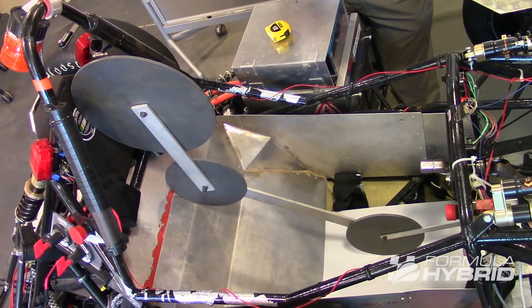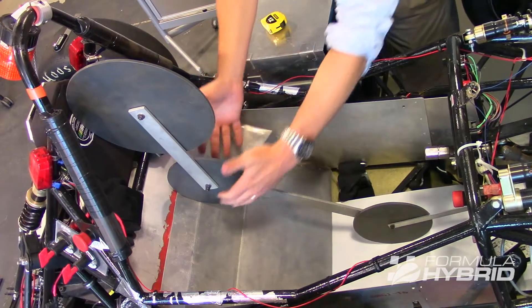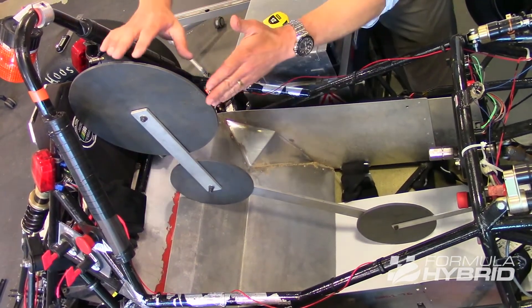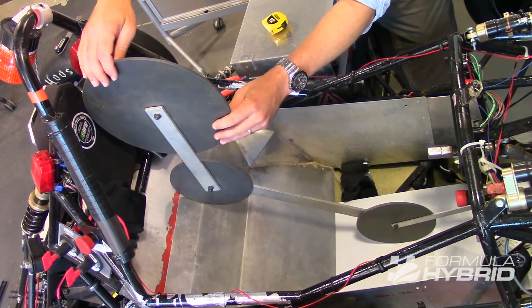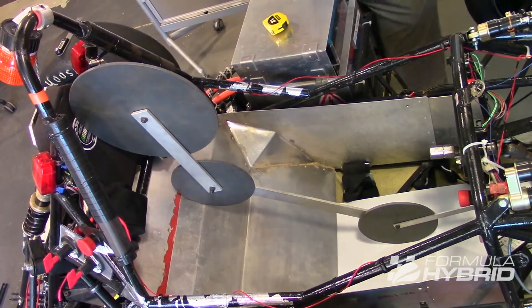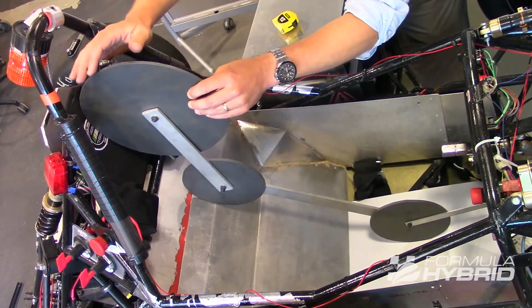Nominally, PERCY would have his own pads and driving equipment. PERCY's shoulders then sit back here close to the shoulder harness mounting bar. PERCY's head sits against the headrest and can be up to one inch forward of the headrest, but no further than that. We will also look at the headrest and see that PERCY's head is at least two inches from all sides of the headrest.